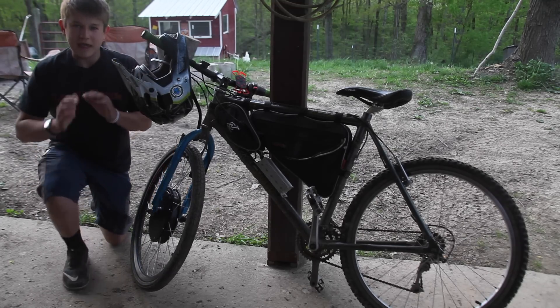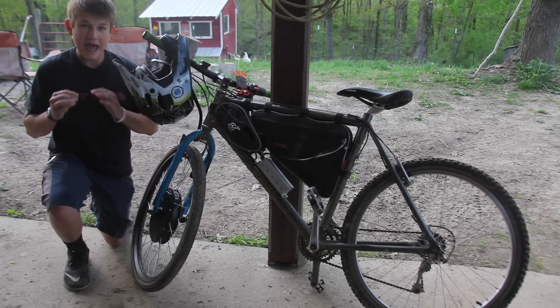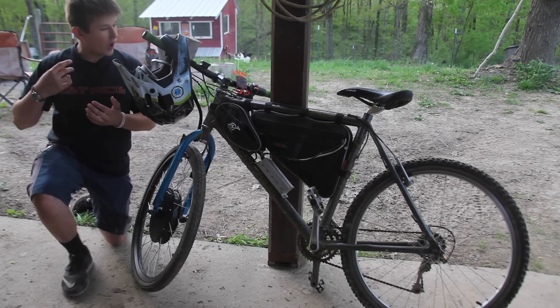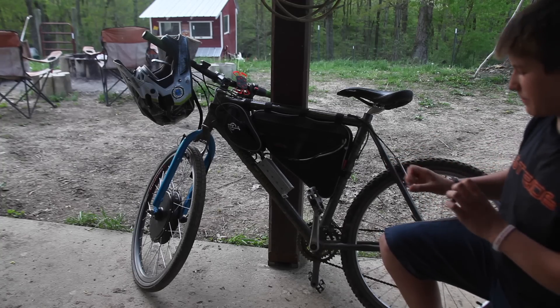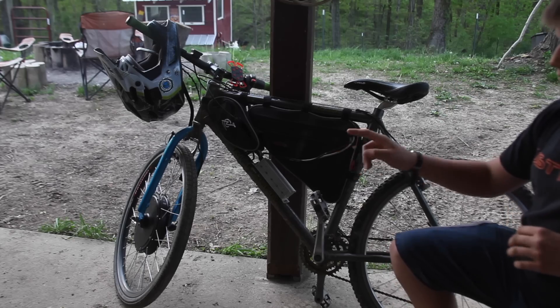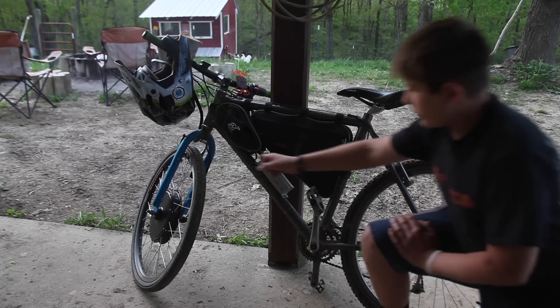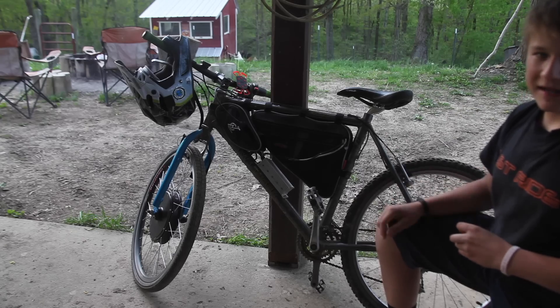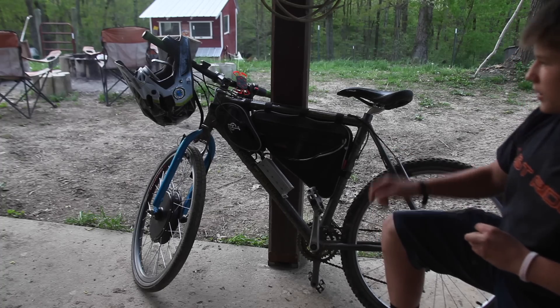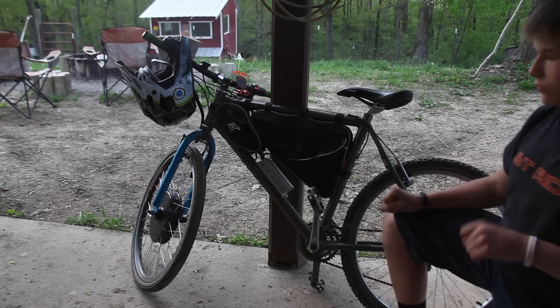The e-bike is finally complete. I've been riding it for about a month and it has been perfect — running strong and a lot faster than the other one because it's lighter. Quick recap: the first thing I did was mount the electric motor on the front forks. If you're going front wheel drive you need really solid front forks, because I've actually broken two sets of forks due to how strong the motor is — they were made of magnesium alloy which is brittle and can't stand the torque. I did get some special front forks and the motor has been great and solid with those.